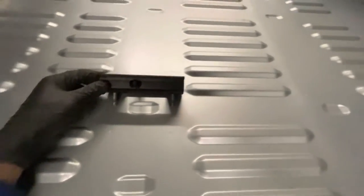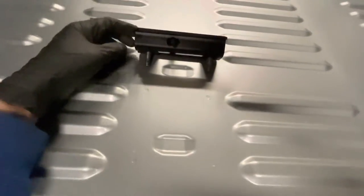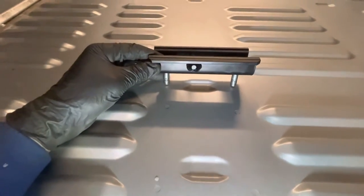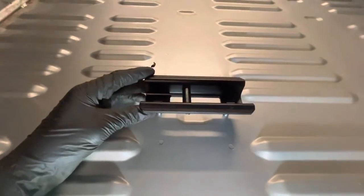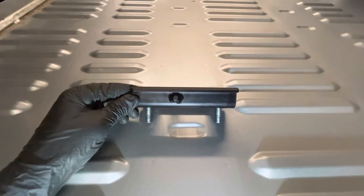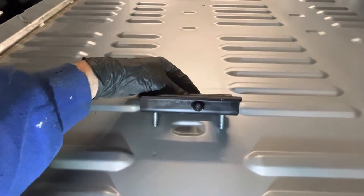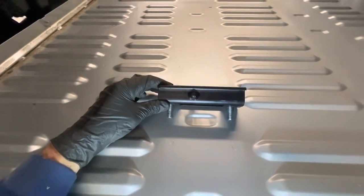As you can see, you can get the bracket — it's got the dips in it like on a normal combi, apart from it just hasn't got the holes. Let's get some weight on there — it goes like that. I'll mark where the studs are, then drill the hole. If you look, the hook is off-centre, so that goes towards the front of the van — not the other way. It wouldn't matter if you made a mistake drilling holes, as long as when you bolt the bracket in you've got it the right way round.